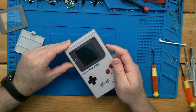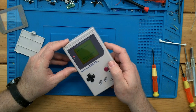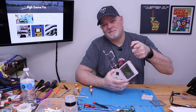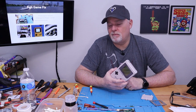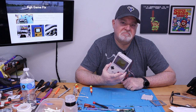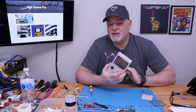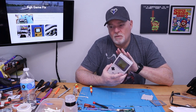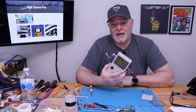All right. As you can see, our lines are gone. And this is just our standard test cart. So that's about it. As you can see, it's not that hard of a procedure. Like I said, horizontal lines — don't even bother with. Just plan on an IPS screen. But vertical, it's not too difficult. When you start first into it, it looks like you're going to maybe make it worse. But keep the iron at kind of a low-ish temperature, work it real gentle, take a step back, let it cool, and it usually almost always comes back to life.